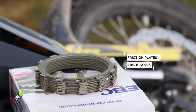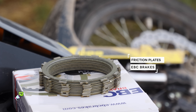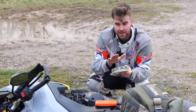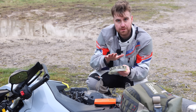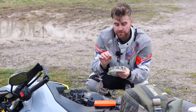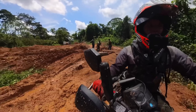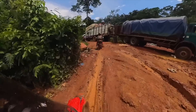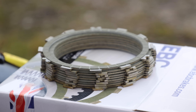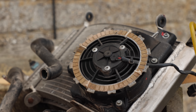Clutches are designed to be a certain size to allow the clutch to engage and disengage effectively. When that friction material wears away, the clutch pack literally just isn't big enough for the springs and the pressure plate to push down on them and engage the clutch. So we need to solve this in quite a dirty way. Firstly, Noraly mentioned she didn't carry a spare clutch in her video — I get why, it's a lot of bulk, but we can be kind of clever about this. It's an old Dakar trick, but carrying a spare clutch plate tied to your radiator fan is a great idea.